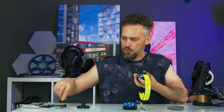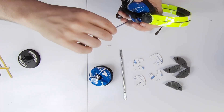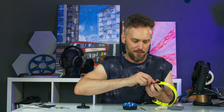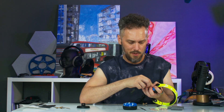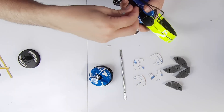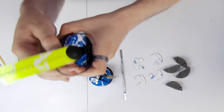The other side is a bit trickier. Probably 90% of pairs out there are going to have T6 screws, so you'll need a T6 screwdriver to undo these screws on the cable clamp. Very old pairs will have Phillips screws but they changed in 2012. To save losing all these little bits, put the screws back in the holes. Then again: unplug the cable from the top, slide down to the bottom, and pull it off.